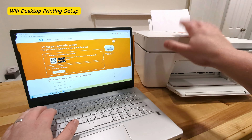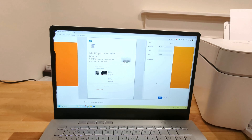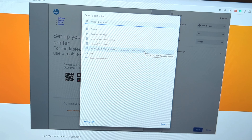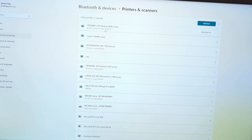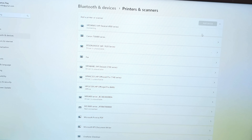So now at this point, I'm sure you're probably saying, that's great and all — we got it set up on our phone, but what about our computer? So here I'm going to hit Control-P because I want to print this page. And so on your browser, because it's now connected to the internet, we can go down to See More and allow your computer to find this printer. We're not seeing it inside of here because I haven't added it yet, so you can click on Manage. And then under Manage, you can click Add a Device on Windows. It's going to refresh, and it pops up nice and fresh right on top. We click Add Device — when it does that, it's going to connect to the printer and set everything up.